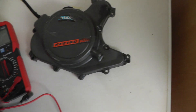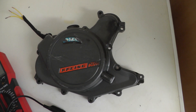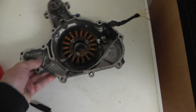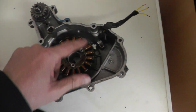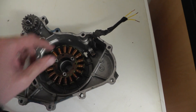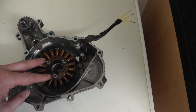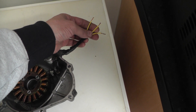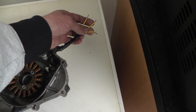I'm going to do a test on this generator — this is off a KTM Duke 125. That's your stator there, with three different windings and hence three different wires. They do different functions: one wire will run your lights, your charger, and the other electrical system, perhaps your ignition.